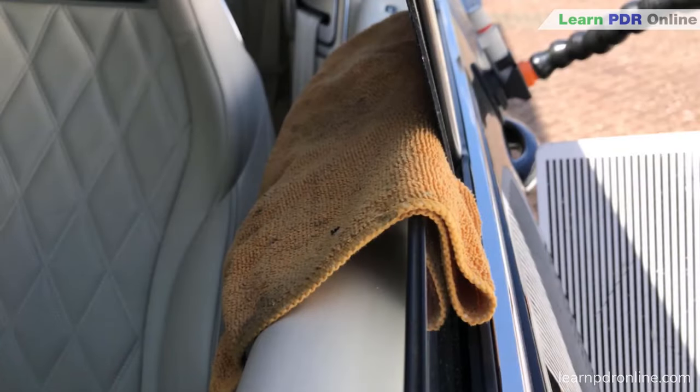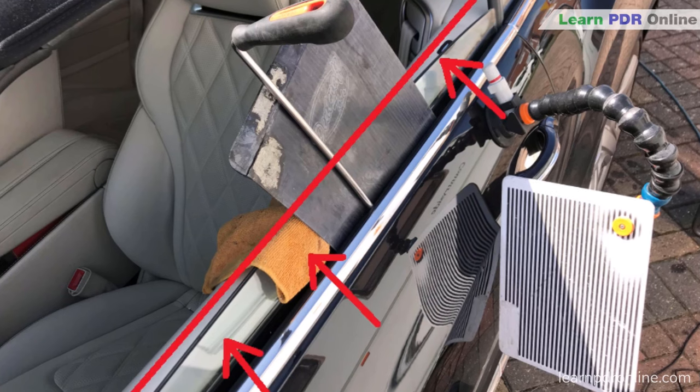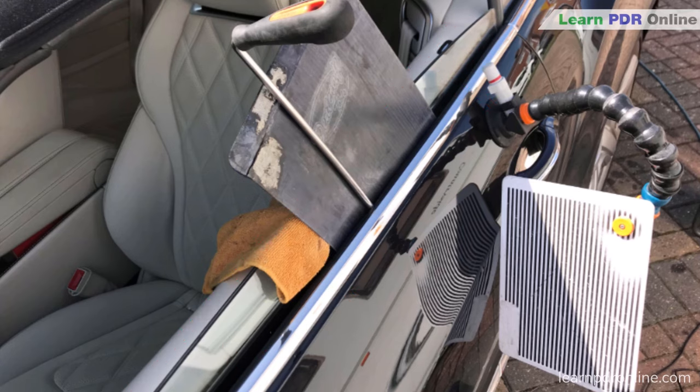I've got a microfiber cloth to give a little buffer between the window and the window guard, but most importantly I do not have this window all the way down to the bottom. If it's at the bottom, as you start applying your wedge or putting a tool in, you can fracture that upper section. I've got this one about three or four inches up from the bottom so that when my window board and wedge go in, I'm not levering off the very edge of the glass where it sits most fragile.